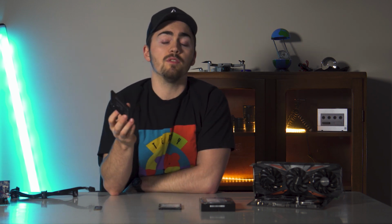If you're planning to use your computer mostly for watching downloaded movies, working with documents, and browsing the internet, a hard drive may be a better choice for you, as they offer more space for less money. If you plan on doing some video editing, plus some mid-range gaming, then a SATA SSD may be for you, as they offer the benefit of higher speeds than hard drives, but also a lower price than an M.2 drive. If you want the fastest boot times on your operating system, the fastest load times in your applications, the smoothest playback in video editing, and the fastest everything else, then an M.2 NVMe drive is probably for you.